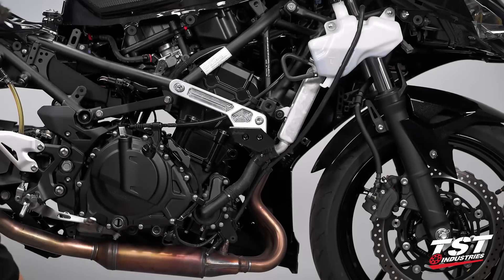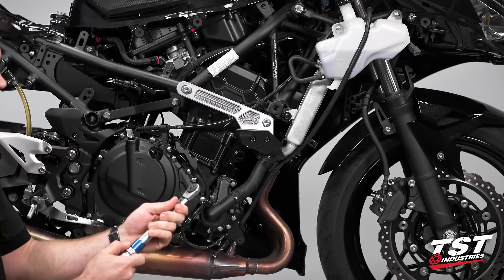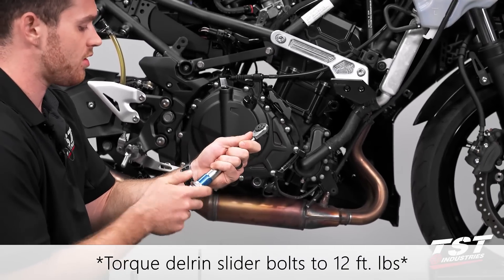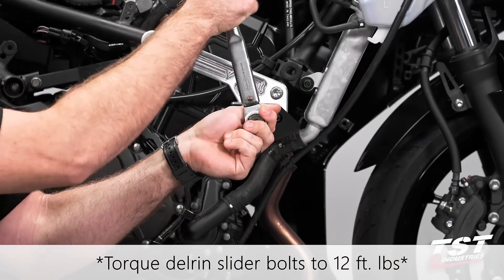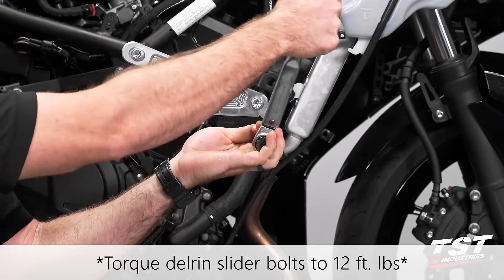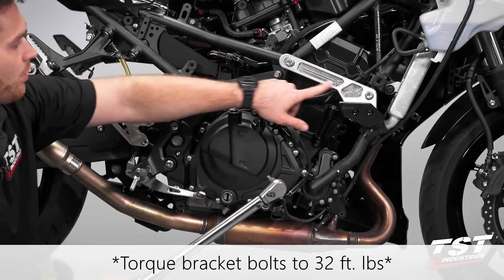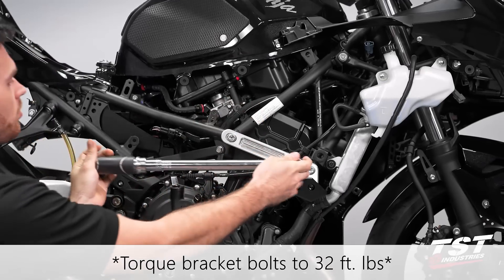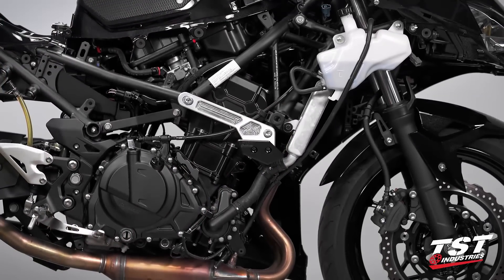It's an aluminum component with a steel bolt going into it, so be careful not to cross-thread. With that tightened down, it's time to bust out the torque wrenches. Torque down the Delrin component first — using a shorter-range torque wrench, we're going up to 144 inch-pounds, which is 12 foot-pounds. Keep that M6 allen key in place. You'll hear a very audible click. Then switch to our larger torque wrench set to 32 foot-pounds — that's the OEM spec — and tighten down the two M10 fasteners. One, two — done.